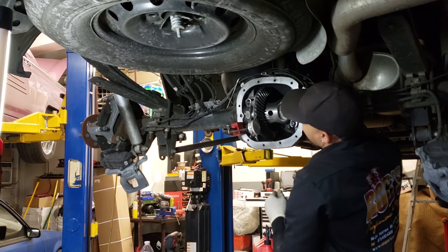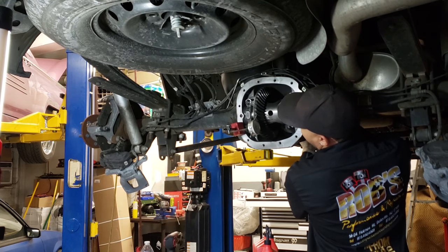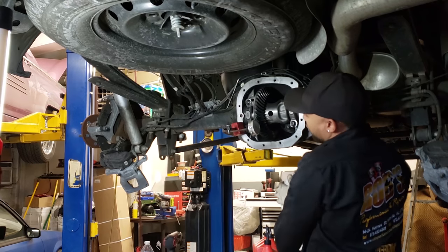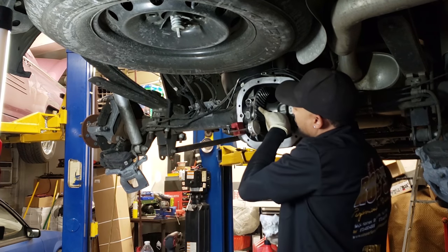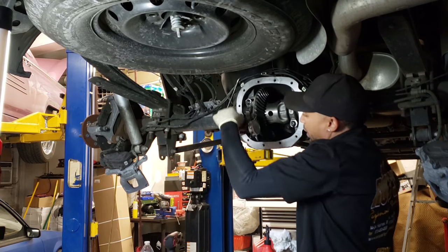We're gonna roll it back to zero. So I'm rotating the rear to the right by the pinion. And you want to be on the nose of the gear, not on the edge of it, but like towards the edge of it. We still got a flat surface that you can contact. 11 and a half, so we're good to go.